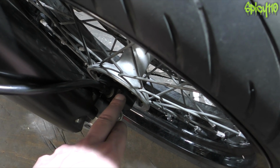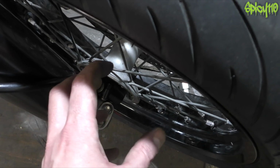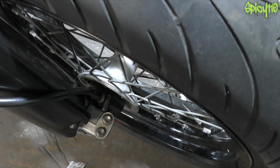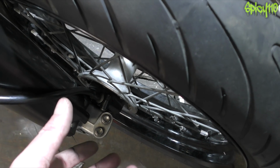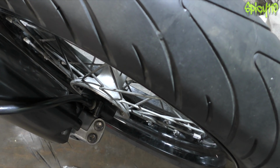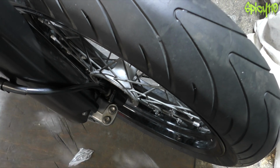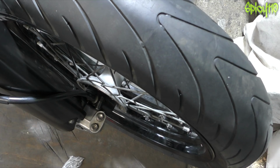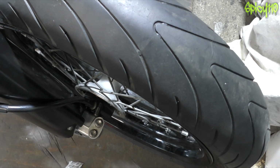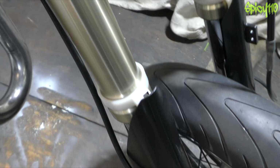Okay, so I just made a mistake as to where the Speedo hub itself sat in an orientation, just a very small amount. So I've seen online people saying you should put it this side of it, but stock is the other side and it works better that way, so I'm cutting it back to stock. To do that, I had to take the skateboard wheel sliders out, release the axle, just pop that round the lump, then get that all back in line, then get this on, tighten that in because that's what allowed the clip to be the right way around.